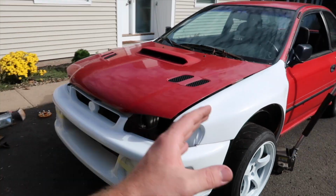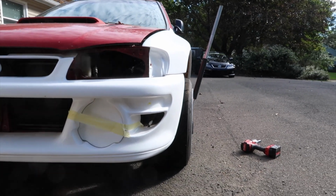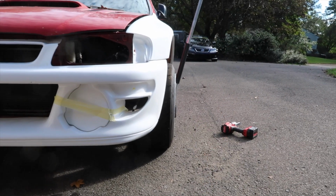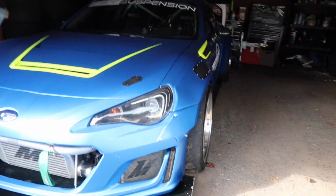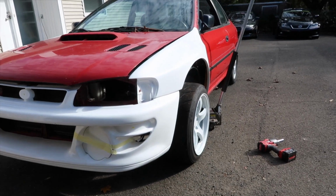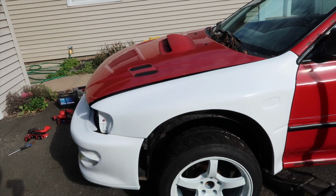So naturally, with the McPherson style suspension that this has, when you lower it, it's gonna automatically negative camber it. So it'll tuck it in just a little bit, and I like that, like, I don't know, meaty, slightly aggressively cambered wheel. Not like Stance Nation, but like you guys will see. And actually, my BRZ kind of is like it. It has like a decent camber to the wheel, but track oriented. And so I feel like those will fit really nicely once it's actually lowered to its proper height.